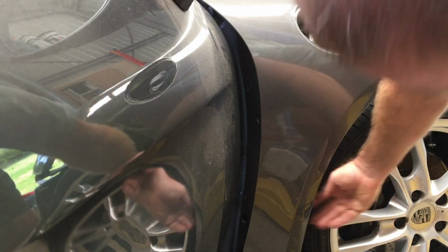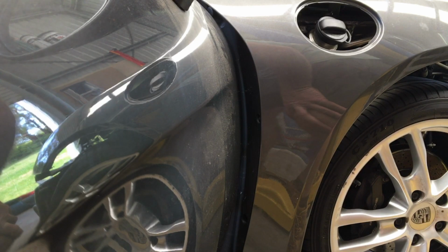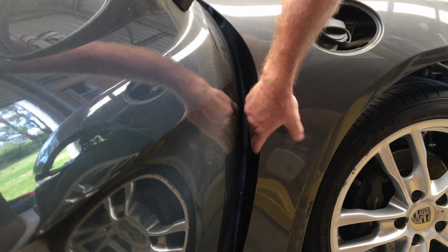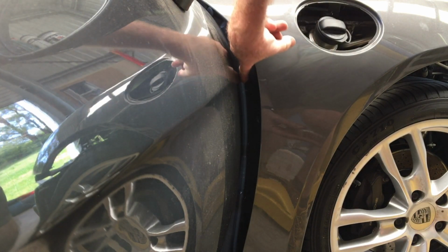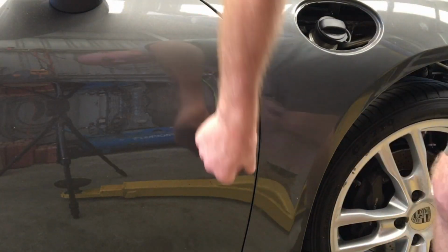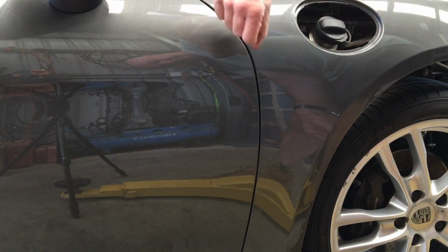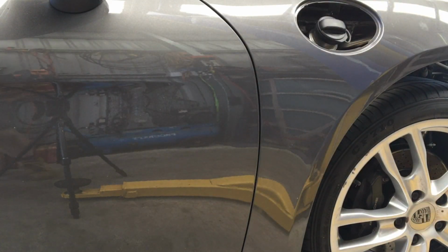Push it out rearwards, and I'm just going to put my hand inside here and grab that and pull that out. And then this thing will come loose, but then to get it out, there's just not much room, and there's the risk of damage as it slides out here on the leading edge. So before you start, you may consider putting some masking tape along here and wrapping it around that edge there so you don't do any damage to it.